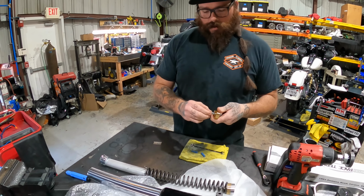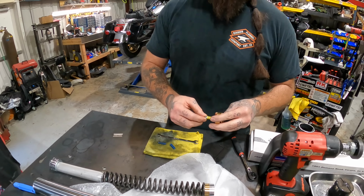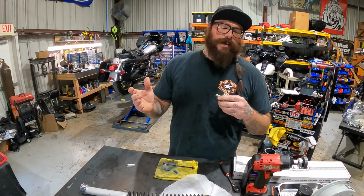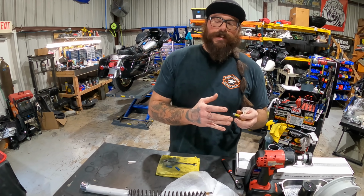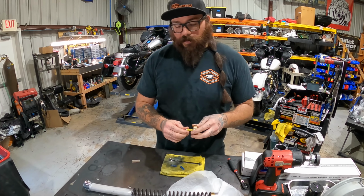But this spring, when you set zero lash, we set these up right now with three turns past zero lash. We'll kind of feel it out. Again, there's no exact science. This is all a feel it, try and describe what you're feeling, and then we go back in and we can modify it to fit exactly what you want.